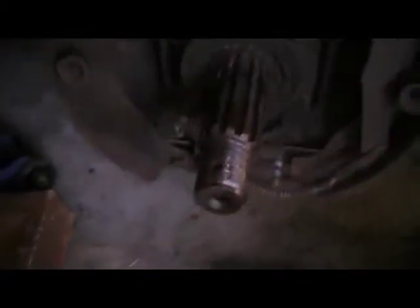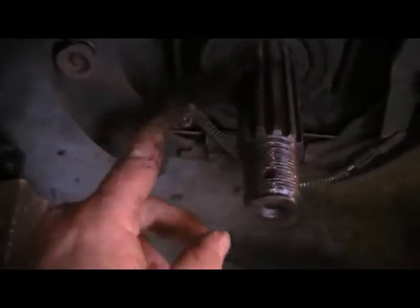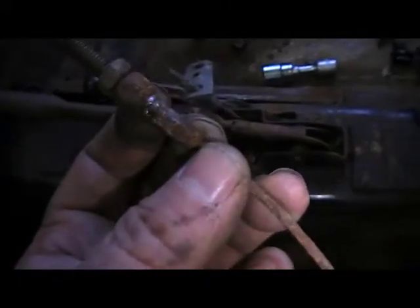It's just on a hook on this lever, so that just needs unhooking. But there's a mount which bolts in from the other side, clamping it in position first. Now my next step, if this cable wasn't snapped, would be to undo these two lock nuts just here. But because this cable's snapped, there's nothing holding it in place, so it will pull straight through. They're just two 10mm lock nuts — very simple to remove.